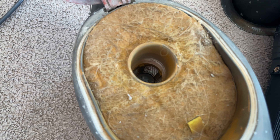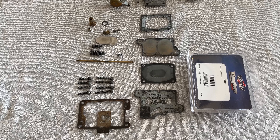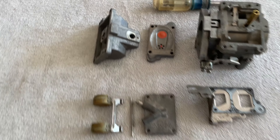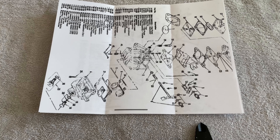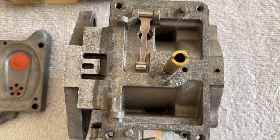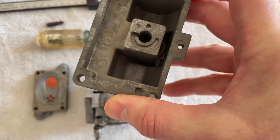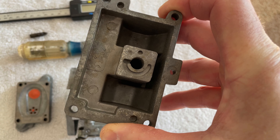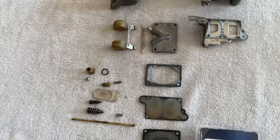Filters are now rust-colored — I'm probably going to get in trouble for that, but we'll clean them before anyone sees. It's time to get our Walbro carburetor for our 1974 Arctic Cat Cheetah back together. I have it all laid out on a white towel. You can see the ultrasonic cleaner and the Simple Green did a really good job cleaning out the carburetor — you saw it previously and it was in pretty bad shape, corrosion and rust-wise.